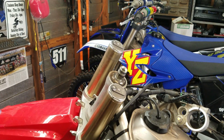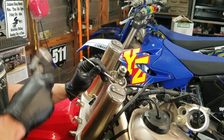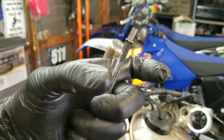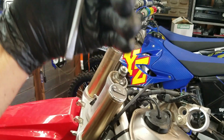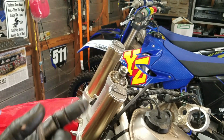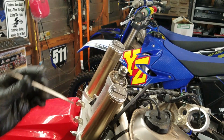Because during full throttle, the piston will be heating up quicker than the cylinder will. And what we're trying to avoid here is the piston expanding. Metals expand when they get hot. We're trying to avoid it expanding so much and faster than the cylinder does that it increases the friction between the piston and the cylinder wall to the level that the side of the piston starts melting off aluminum. That aluminum gets up into the piston rings, your compression goes south, and the bike shuts off. We're trying to avoid that. So you want to avoid sustained full throttle on the first ride. Make it a shorter ride, 8 to 10 minutes long.